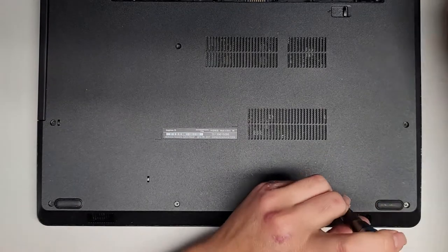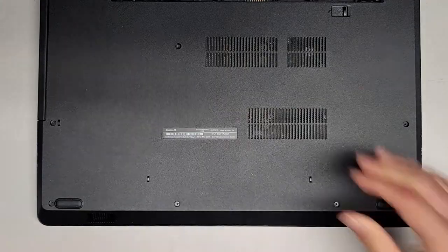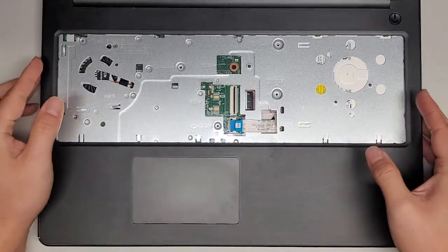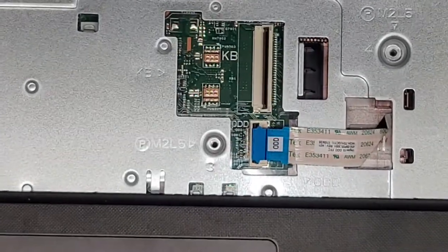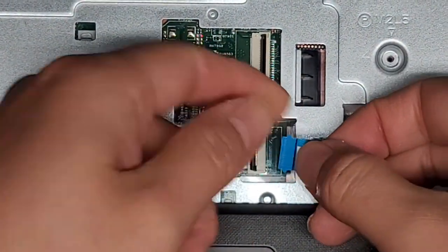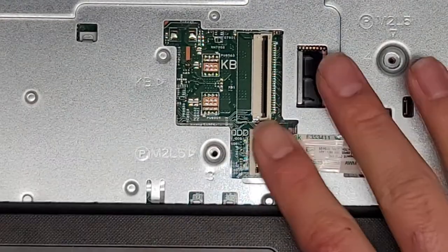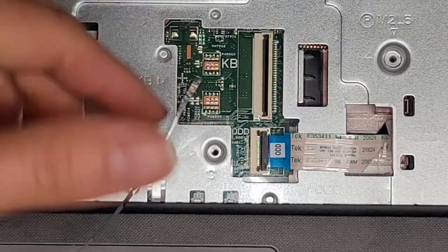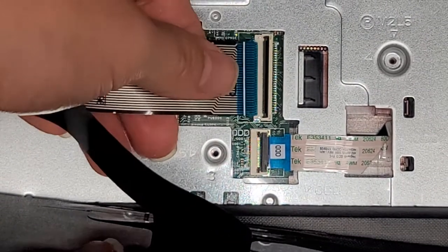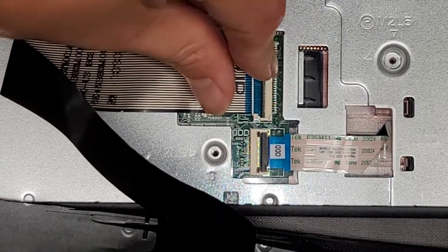Let's go ahead and reinstall the keyboard. Flip this computer over and lift it back up. Reconnect the optical disk drive cable — make sure this latches up. If you can, grab the blue tab instead of the cable itself to help guide it. Flip the latch down. Now get the keyboard connector — make sure the latch is up. This one you have to hold from here; it goes in slightly at an angle. Wiggle it until the wings go past those raised white parts of the slot, then flip the latch down.